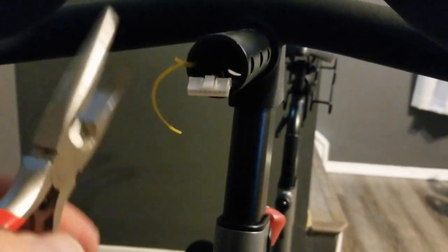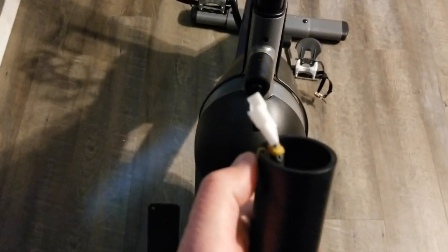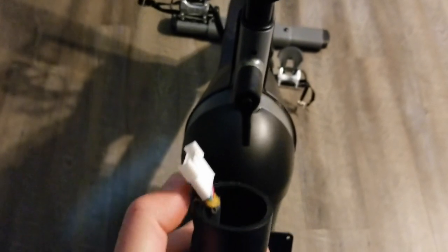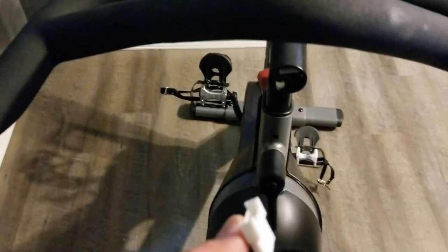Once it's on the edge though, we can keep it in this general area, and we're going to use that arm now to attach it to the wire assembly that goes up into the monitor. So this is how the wiring harness should have looked for us on the main unit right here. Again, you see how it's tied off right next to this side hole with the rubber band. Unfortunately, ours had been pulled way back down into the assembly on this one. So what we're going to do is cut this rubber band, making sure the wiring assembly doesn't fall back down in here, and then connect the two pieces.